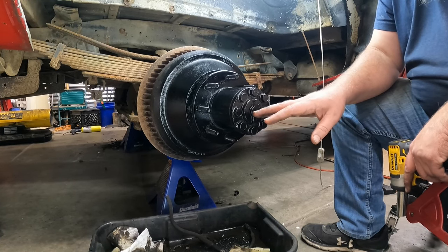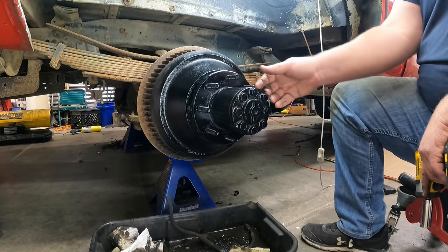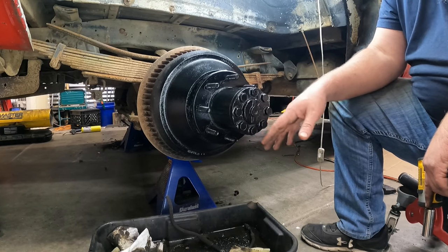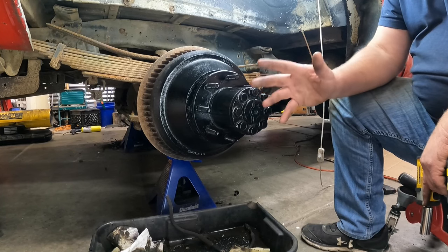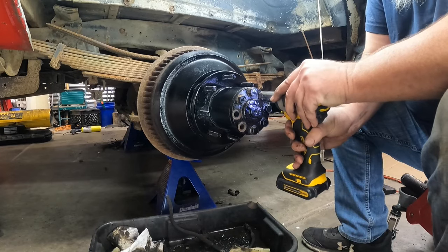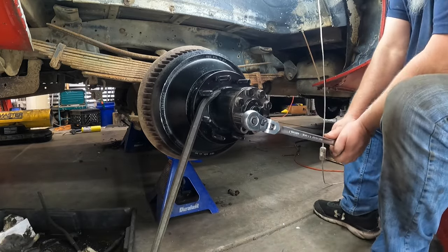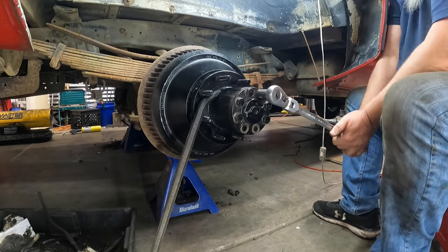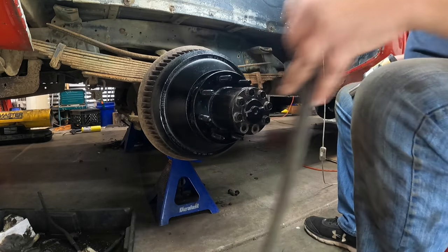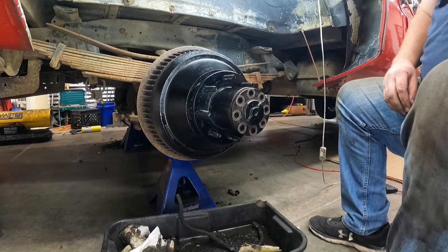To get the drum off, you've got to pull the axle out. There's a lock ring, a nut, and a couple other things to deal with inside. We'll go ahead and break these eight bolts loose - these are three-quarter inch bolt heads. A couple of notes before you get started: make sure you have a drip pan underneath because it should drip out some gear oil, and have plenty of paper towels or rags handy because it's going to get messy. Only two of these suckers were loose - somebody got a little overzealous cranking these down.